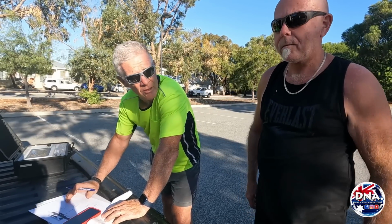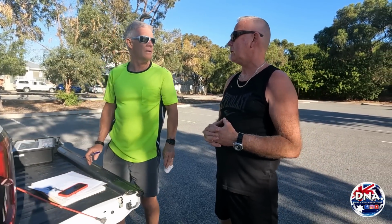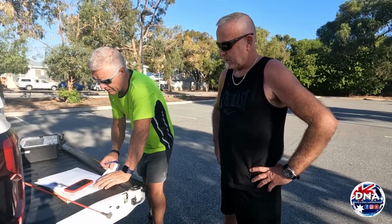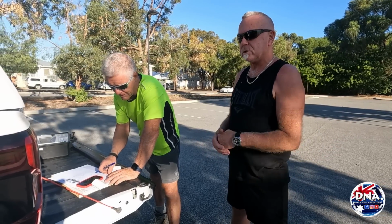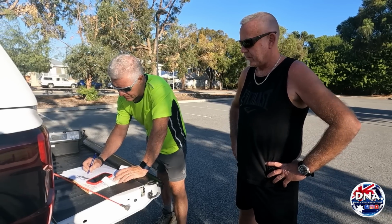How does it travel when you haven't got the caravan? Is it stiff? No, because we don't have coils. We've got a coil delete, so it's just big airbags. The whole thing's a bellow, so it doesn't matter if you're empty or full. It rides the same. Just when it has more weight, you put more air. Nice.